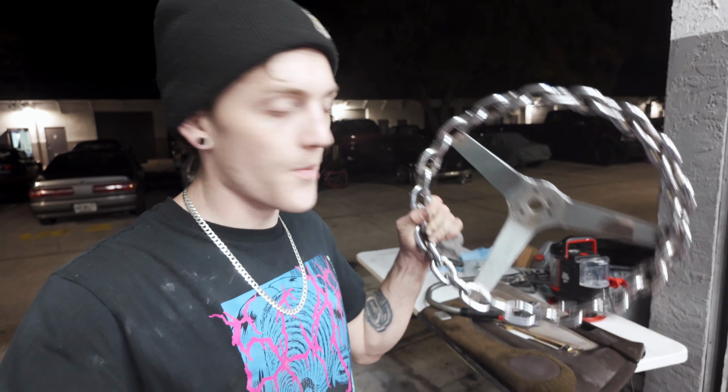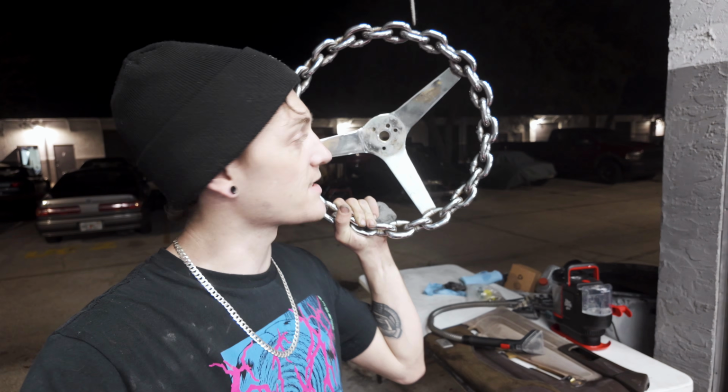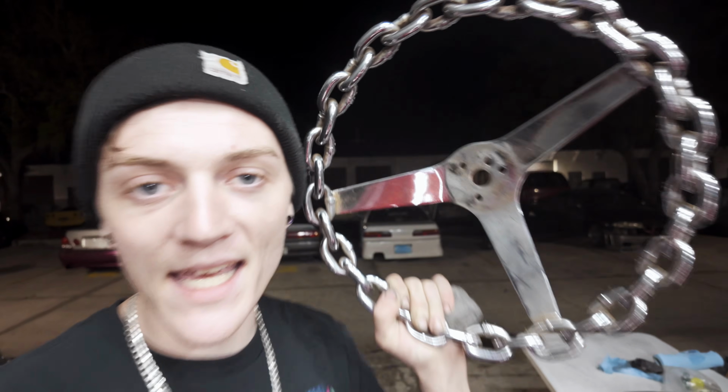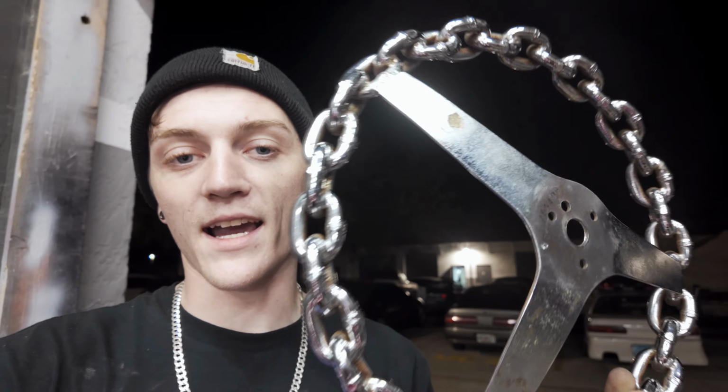before I reassemble the car. And Peck just stopped by and he bought this sick steering wheel for 25 bucks off Facebook Marketplace. Now, this is from 1980, so it's not fitted for the cars that they make these days. So what I'm going to do is template it off a quick release, and I'm going to drill some holes, and I'm going to make this mount to an NRG quick release setup. So let's get cracking on this thing.